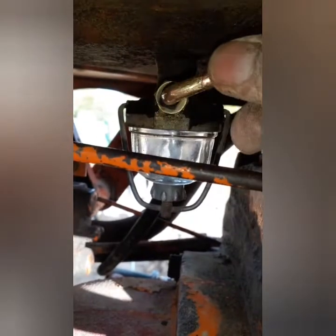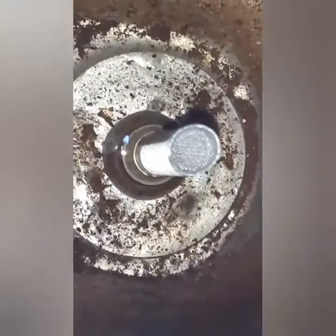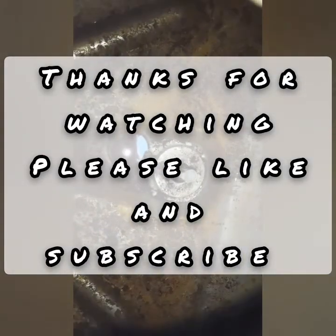All right, let's try starting it — let me open this valve here. Let's see how fast the fuel comes out because it's supposed to come out — well, I drained the fuel so... that strainer is a lot higher now, as you can see, so I really have to keep more fuel running in there. The tank doesn't look all that bad. Let's put more fuel in it — this time I bought some ethanol-free fuel for the tractor.